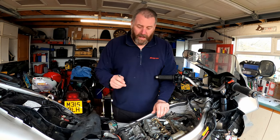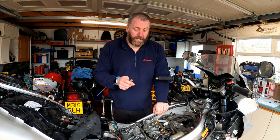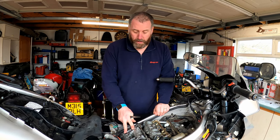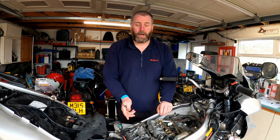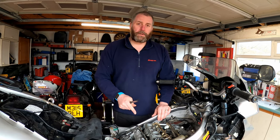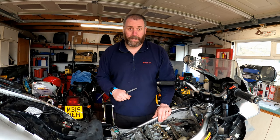They're 0.35. I'll whip through those. Then what I'll need to do is obviously rotate the crank to the 1T position to bring cylinder 1 into TDC on the compression stroke. Again, that's when the two lobes are up and pointing towards each other. So I'll crack on, rotate the crank, do cylinder 1, and then we'll bring you back in.